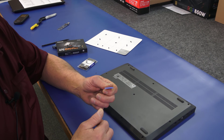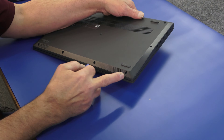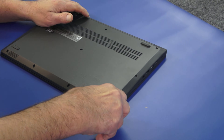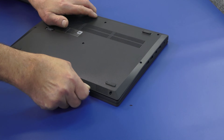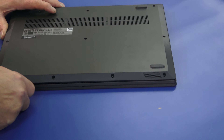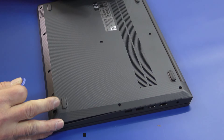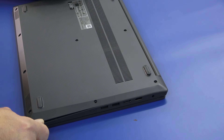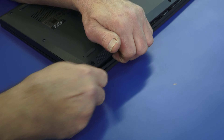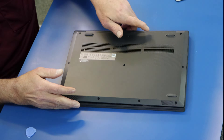I'm going to use a plastic spudger tool here — I'll have a link down below where you can buy a pack of these online, pretty cheap. So I'm going to get right into this little seam here. There's a seam anywhere along the edge; I usually like to start in a corner. Get it in there good and just start working it around. Just got to be patient when you're opening these up, and always protect yourself against static discharge. Just got to be gentle around where the ports are on the side — you don't want to booger anything up on the chassis. Don't stick anything in there really far because you've got speakers and other components you definitely don't want to damage.